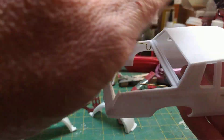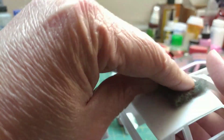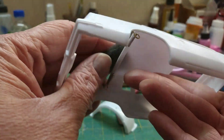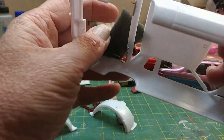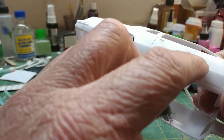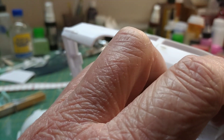Like on the roof of the Cutlass, you just kind of go over it. And if you do this it'll show you any flaw that's in the plastic that you've got to work out too. You'll see there's a low spot — that tells me I need to put a little bit of filler right there.